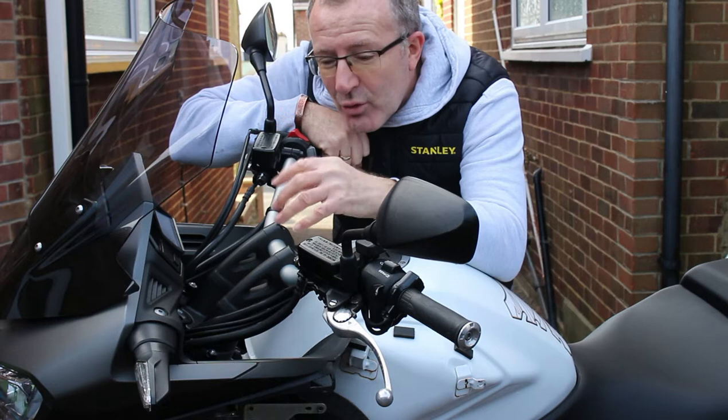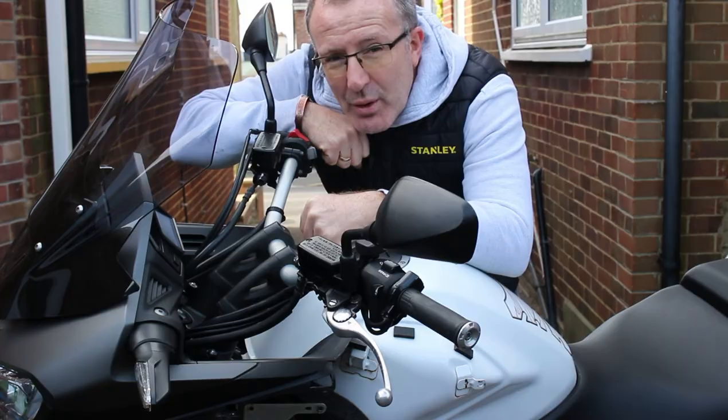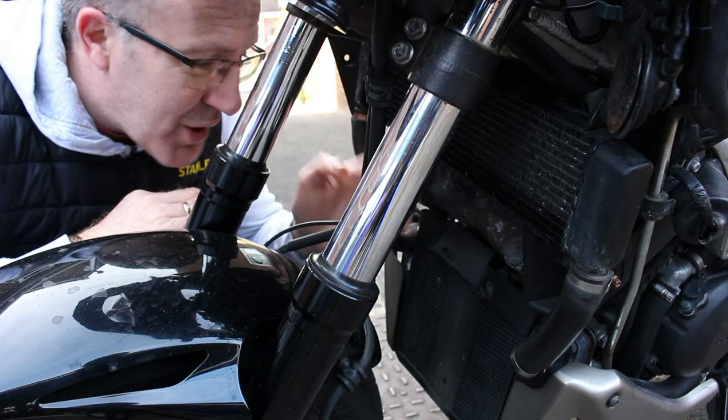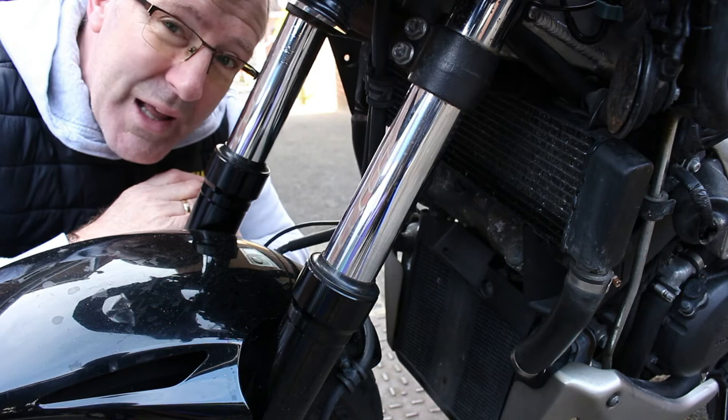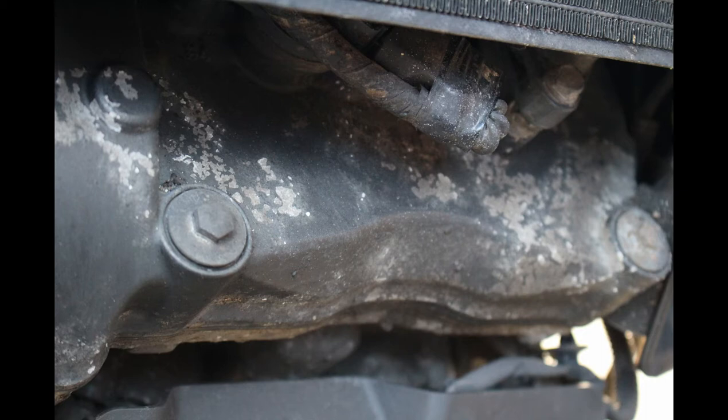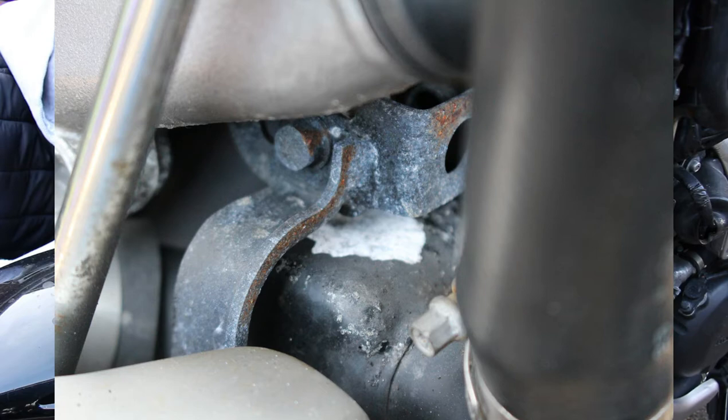Now whilst we want to get those vinyl wrapped parts back on the bike, there is something we need to tackle whilst they're off. What I'm referring to is this cam cover here. What happens is the rain and the salts splash up in the winter time and get onto the top of this part, and unless it's washed off and dealt with very quickly, over time the salt will eat into any paintwork and even metals in this section. So we do have a bit of corrosion, as we saw before on the radiator sections.